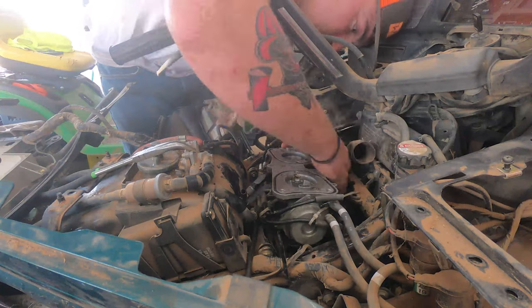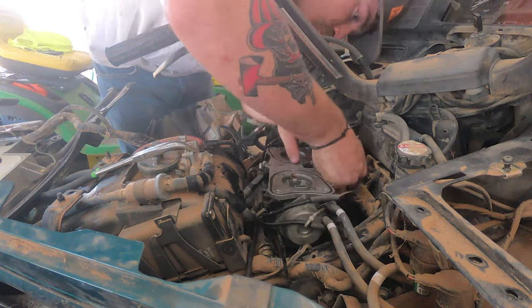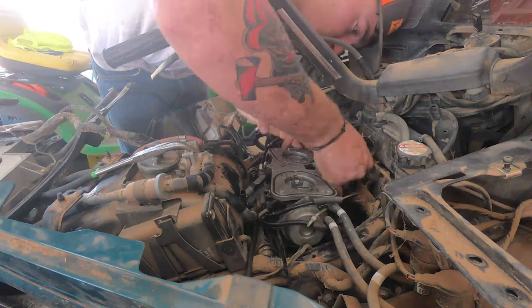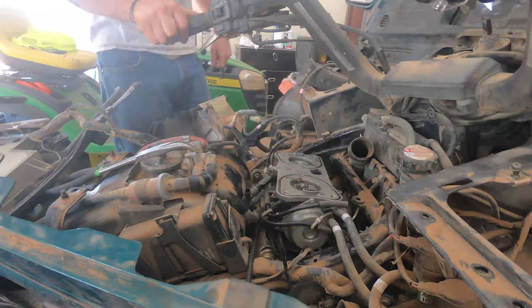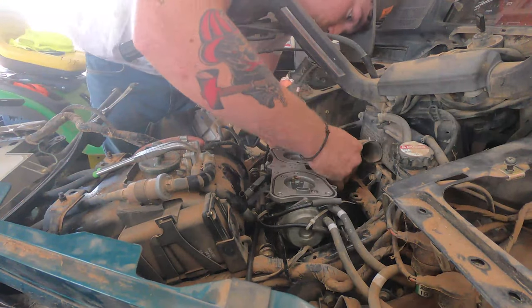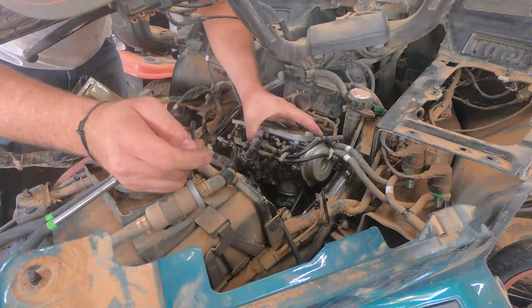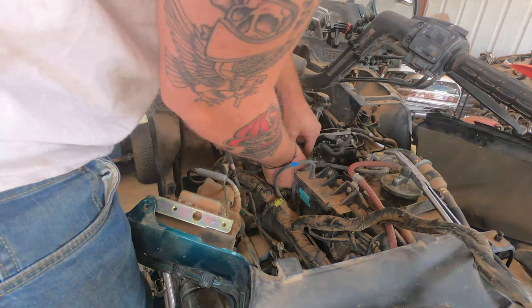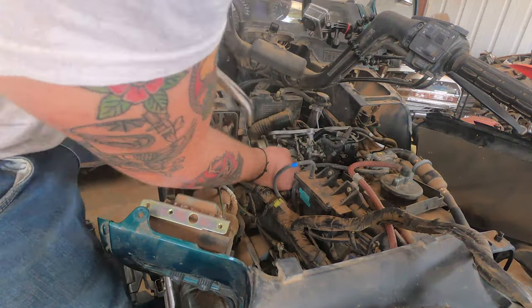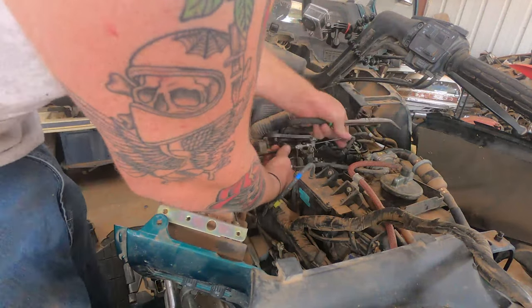In the back, there's a choke cable that is going to need to be put in as well. And those hoses you see near the bottom of the screen with the white lines. Also, don't forget to install your fuel lines — you might need those. Those are going to be on the side of the fuel filter and the gas cap, towards the rear of the motorcycle. You should have taken them off to get to this point, so you should know how to reassemble them. Normally, there's two of them that connect to a T, and then you just connect your fuel line to that T — just depends on the configuration and year of your motorcycle.